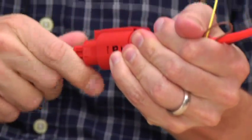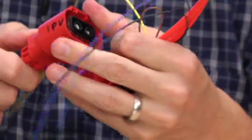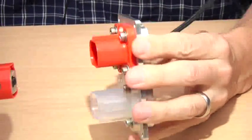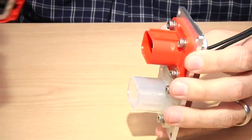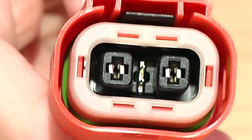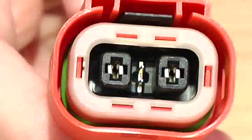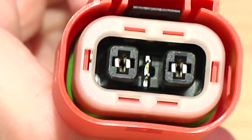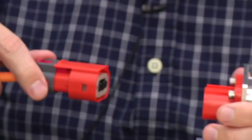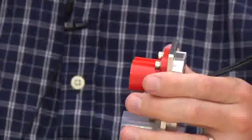While effective, this made for a very laborious process, and it's just plain big. What we did in the next step on our HVA280 system is we took that high-voltage interlock loop and moved it inside the connector. So now, instead of having a piggyback connector, I don't know if you can see it, but inside the connector there is a small shunt that is located between the high-voltage conductors. We have that staged so that as you separate these two connectors, that high-voltage shunt will separate first prior to the high-voltage conductors separating.